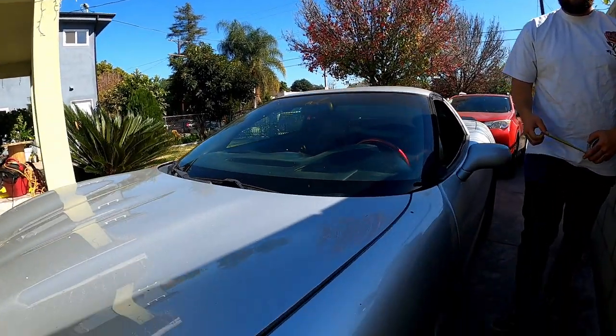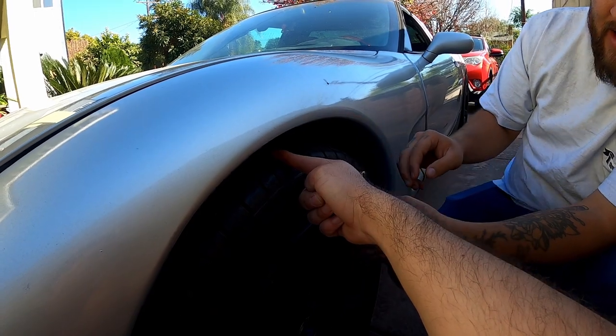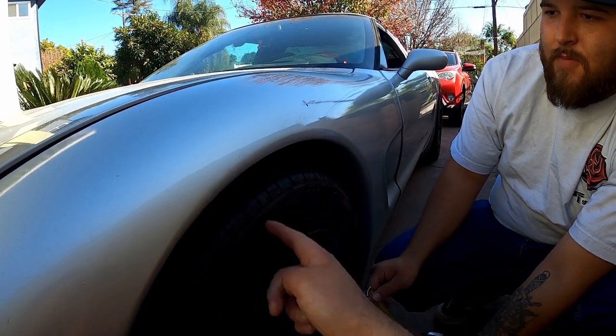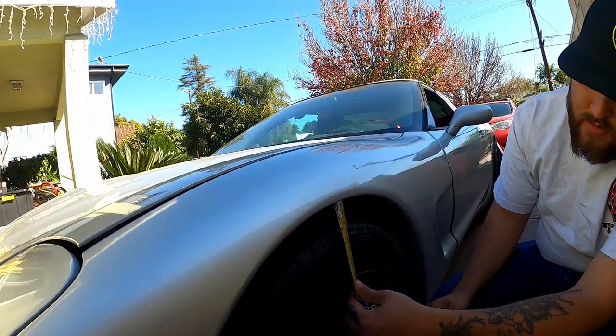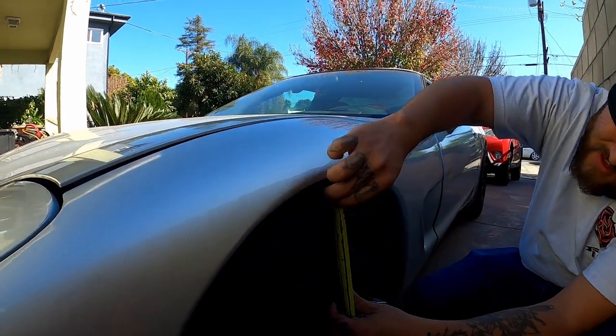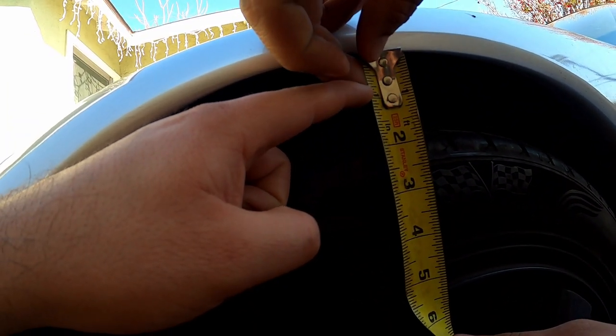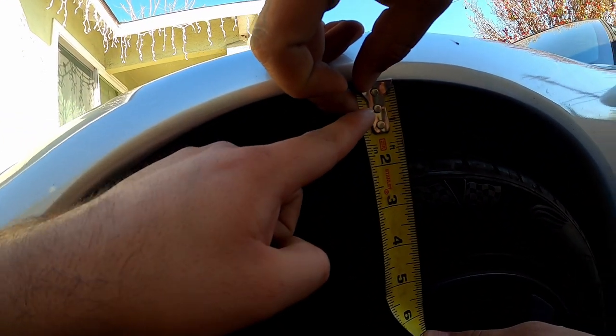You want to drop the front an inch too? Or that's too much? I think that's too much. I just want to leave it at like a quarter? Drop a quarter, yeah, probably. Alright, so let's do a quarter in the fronts and an inch in the rear. Maybe 3/4? Because it's only about an inch and a half. 3/4 would be a lot then. Yeah. So maybe we could always lower it some other day. 3/4 left, it'd be like taking half away of what it's at now.